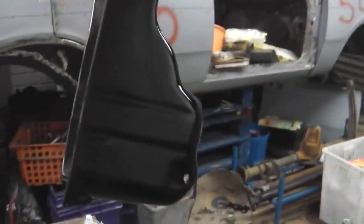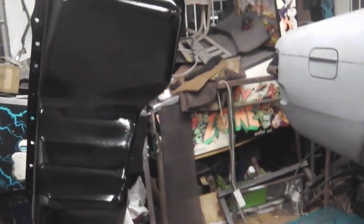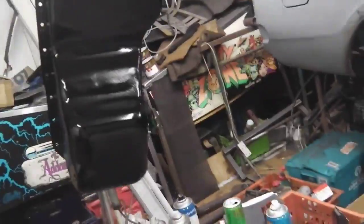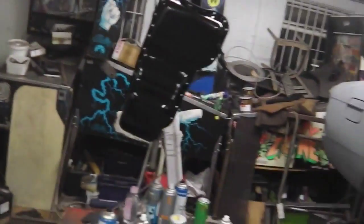Oh by the way, we redid the sump. I've been giving it some 600 grit coats between layers and I've redone the sump. I didn't quite like that very matte finish, so just for those on YouTube who were saying it was a bit too matte - yeah I agreed, and I stripped it down and redid it. I've just been flattening the coats then painting it back up - got a bit obsessed with it really, but looking nice. So that's the sump redone for the engine.